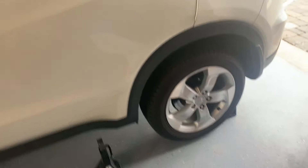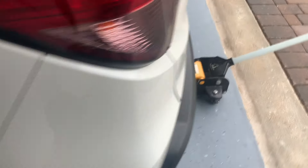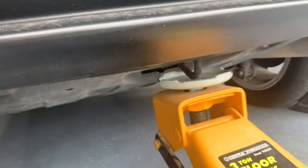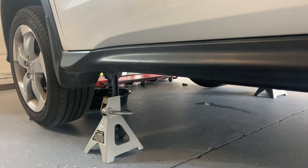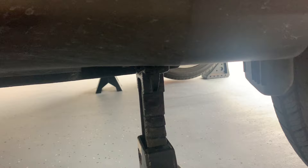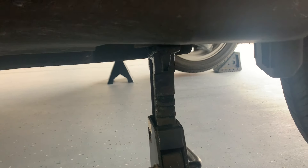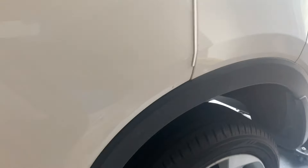The oil change is done — we had a little rain delay. Now I'm going to lift up the back of the car to get it level. The jack point for the rear is right there; I just use that little tow hook and lift the car up. The front jack stand was set to three notches, so I match the rear to three as well. When you drain and fill the CVT, it's important to have the car on a level surface.